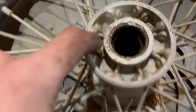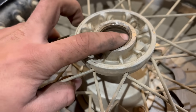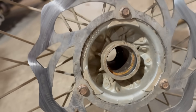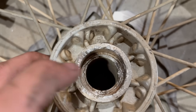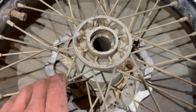That one is pretty messed up. I already nicked up the rim pretty good, which I'm really not happy about. The outside of the old bearing is still stuck in here, so I'm going to warm up the outside and pull it out — that's what I did on the other side and it came pretty cleanly out. After half an hour of playing with it and doing everything, we got it out. It's pretty molested but it should be fine. Let's pop the bearings in and continue building.